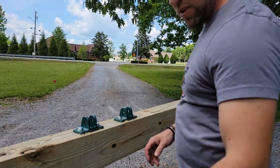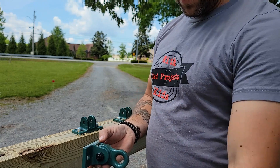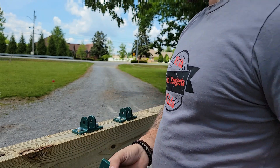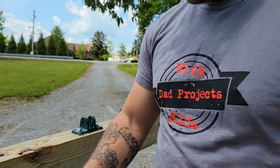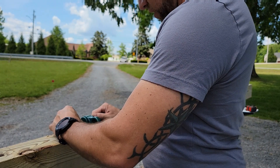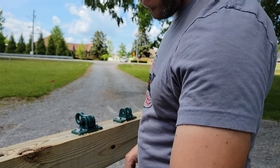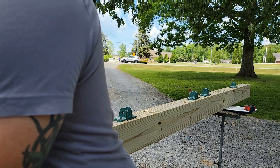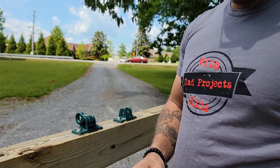One thing I wanted to show you - if you get these off Amazon, which I'll put the link in the description, you've got to take this bolt out and take this piece off of them, because you just can't get a straight shot. Maybe if you had a longer extension that might help. Be careful with them because they do have bearings in each side of them, so just keep the bearings in them and then put them back on your bracket and bolt them on - that's all you got to do. Just a piece of advice if you don't have a long enough extension. And if you're OCD like me, you're going to have all your bolts going the same direction.